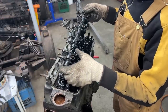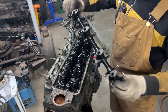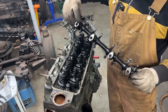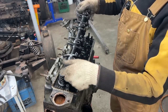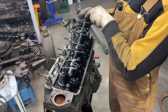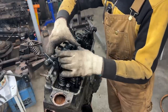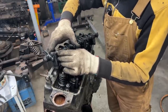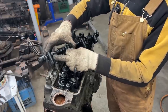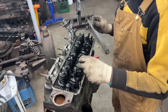We're going to check for ridges under the rockers later, because of the lack of oil especially at the front end — oil is delivered through a hole here on the head that matches a channel up to the shaft. Because this end is far from where the oil comes in, the shaft is sometimes pretty scratched. This rocker slides pretty well actually. We're going to inspect the shaft now and start taking out the push rods.